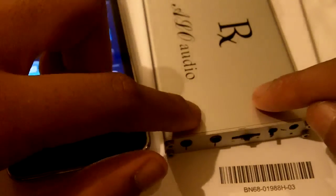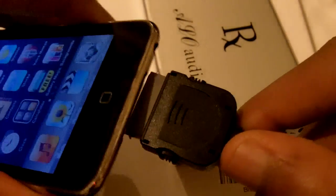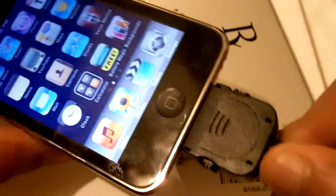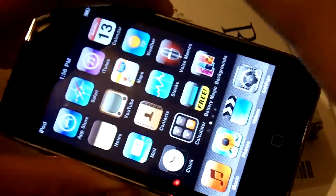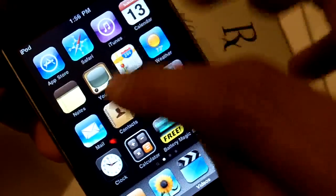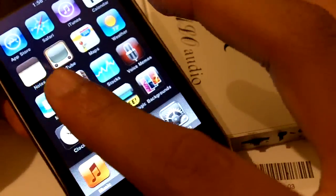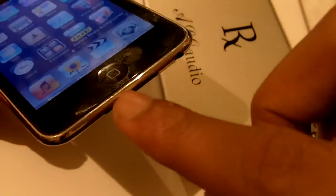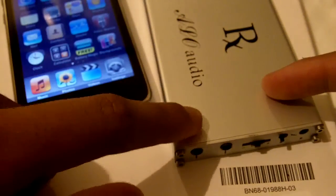What I'm doing here with this external amplifier is I'm going to use this line-out dock cable. This cable allows me to deactivate the built-in amplifier. The digital-to-analog converter will still pull the digital form of your music, but now it's not going to send that analog signal to the built-in amplifier — it's going to bypass that amplifier and send the signal out of this dock. This cable then receives that signal, transports it into this amplifier, and this amplifier amplifies it. In return, I get better sound quality.